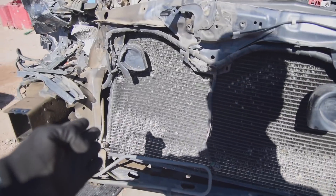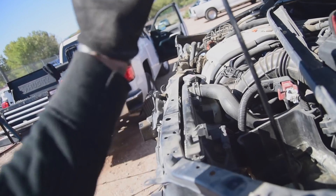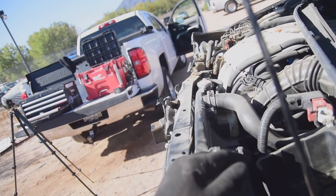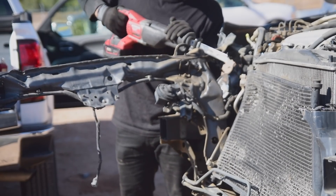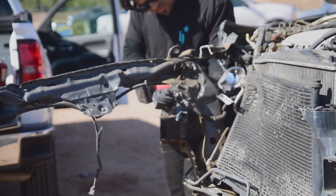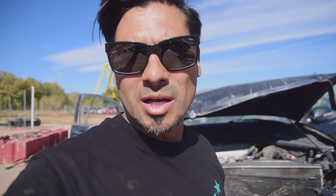We have an AC condenser and a radiator. I think how we would normally do it if this wasn't crunched is pull the radiator out and then we might be able to get to the motor mount without messing with the AC condenser. But you can see that it's all covering it. So I think what I'm going to do is hack this headlight bucket off, expose this core support, and I can open it up like a window over here. I've had hoods follow me before — depending on how heavy the hood is, it could really hurt you. A lot of cars end up not having hood props.